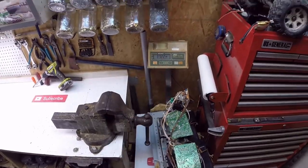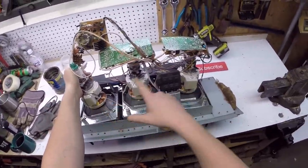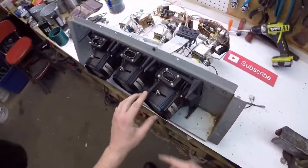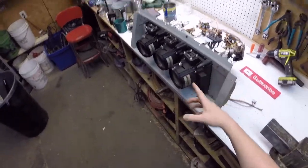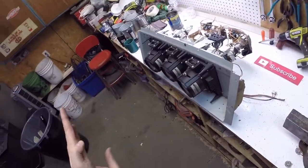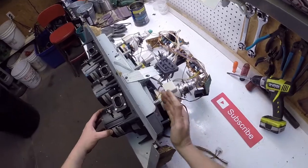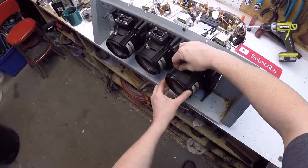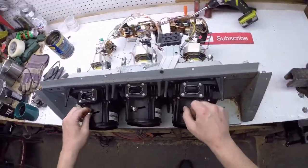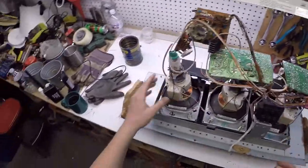Pre-scrap weight: 37 and a quarter pounds, quite heavy. We got some copper. These are three different cathode ray tubes, CRTs - a red one, a green one, and a blue one, RGB. Something I've always wanted to do: these are made using three different mirrors. This usually shines straight up and there is a mirror here, a mirror down bottom at an angle, and another mirror on the back wall which shines it to the screen. I've always wanted to take the screen out, let it bounce off the two mirrors, and turn one of these into an outdoor projector because these suckers are bright.